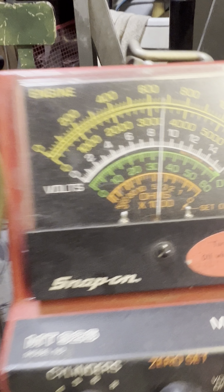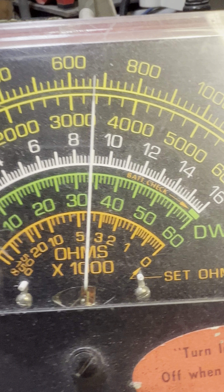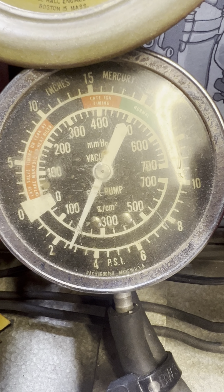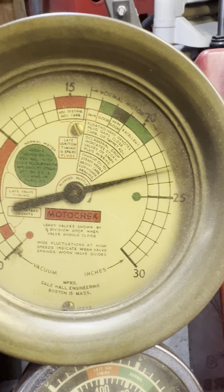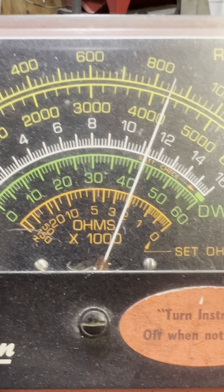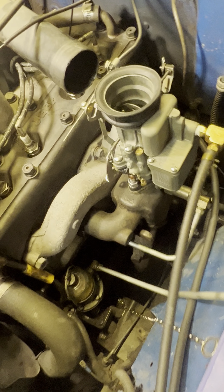The way I've got it dialed in, it's idling at about 660 to 665 RPM. Fuel pressure is at about 2.75. Vacuum looks good — that new throttle really helps — sitting at 23. Excellent. And there's my dwell at 42. Let's go ahead and pull it through.